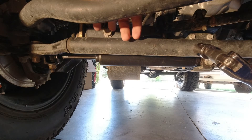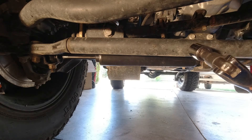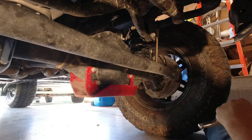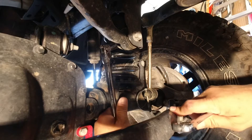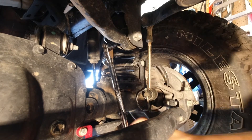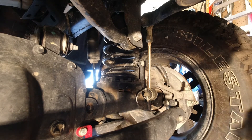When I got back up on the highway, the thing had some very bad wobble — to where you almost couldn't keep control of it. That's when I discovered my track bar was loose. This side doesn't have the flag nut that the other side had, so I'm going to tighten on the nut side. It's tight — that's good.